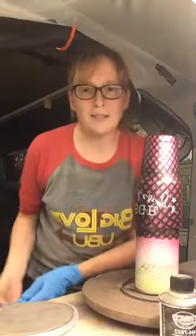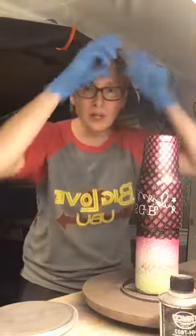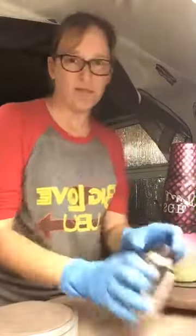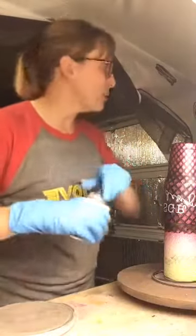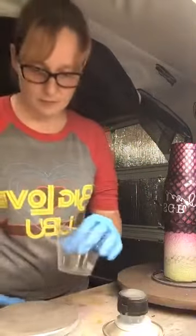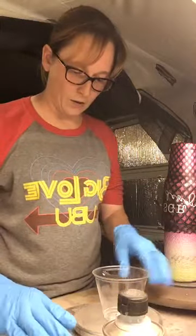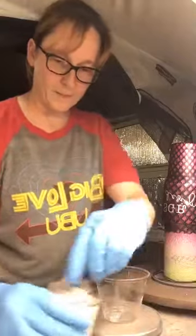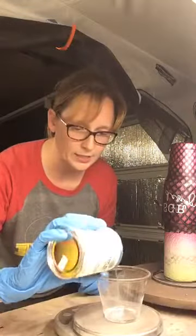I use a wax and degreaser. Tamco has a really good product. I mean, you can get it most automotive stores, wherever. I'm gonna mix this because I've gotten pretty good at mixing it pretty quickly, and then right before I throw it, I'll grab my respirator. Give me 1 second. So yeah, I wipe it down. I make sure it's nice and clean.